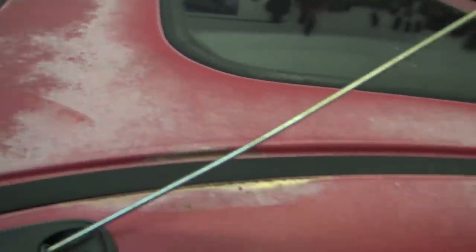The roof is also a nightmare — paint gone, clear coat gone. The trunk lid has almost no red left at all. Now, one of the most important pieces to this process is making sure the car is completely clean. Any powder residue from the clear coat, any dirt or debris — anything on the car has got to be cleaned off so that the Plasti Dip is not only going to bond well but have a nice smooth surface as well. We're going to dip foam system the entire car, scrub the foam in, and then rinse it off really well with a power washer to make sure it's as clean as can be.